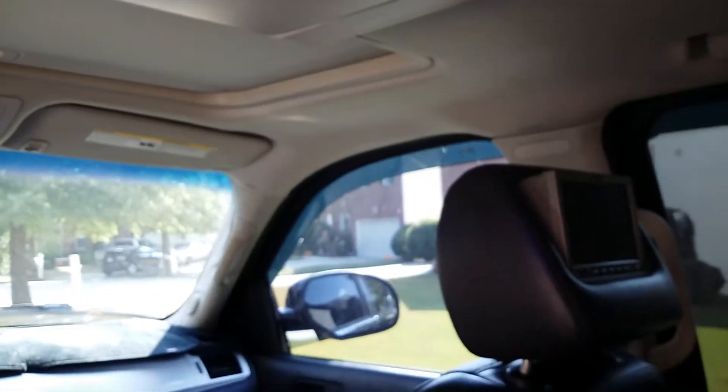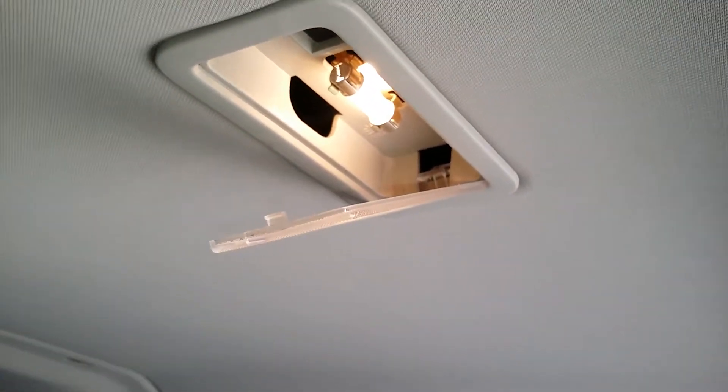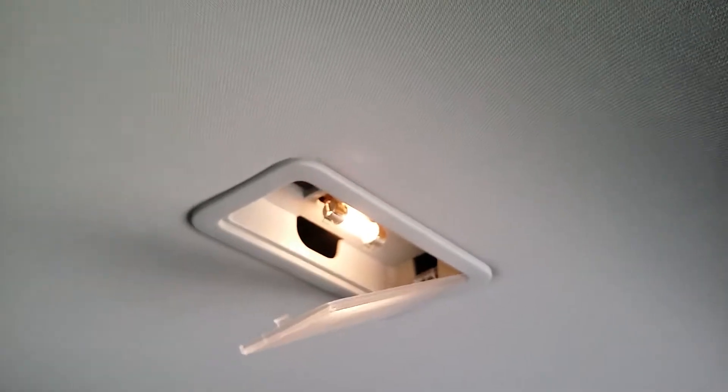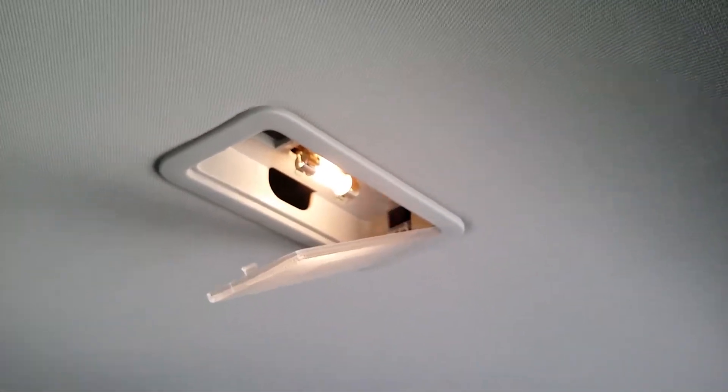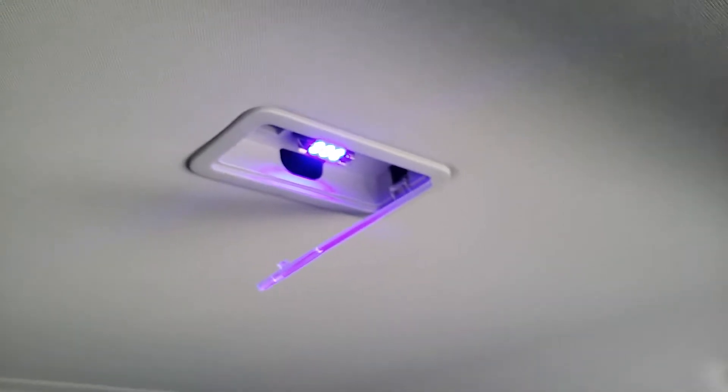On the front I'm gonna go to the rear now, to the trunk. In the rear you just hook it from this side here. All right, so once you pop it down like that, there's a hook on the inside — you just pull it up out of here, or you can try to get the bulb out like that. I just went ahead and popped my bulb out — putting the new one in. All right, I got the new bulb in and we just pop back up our lens.